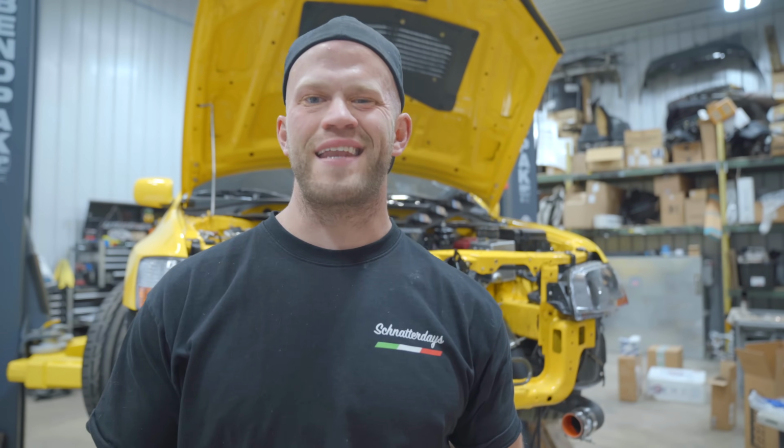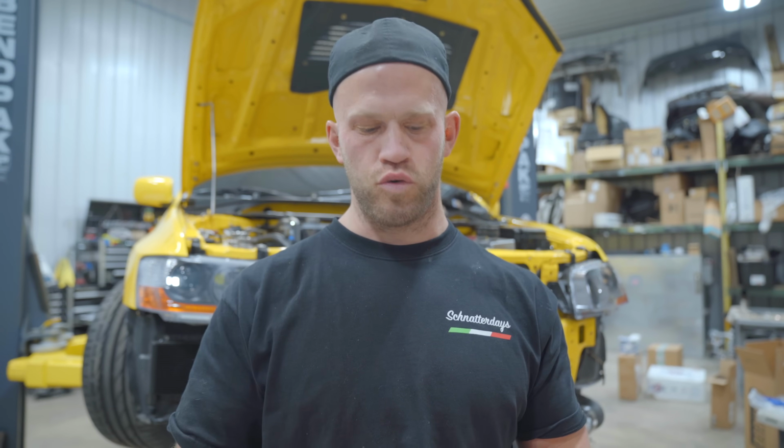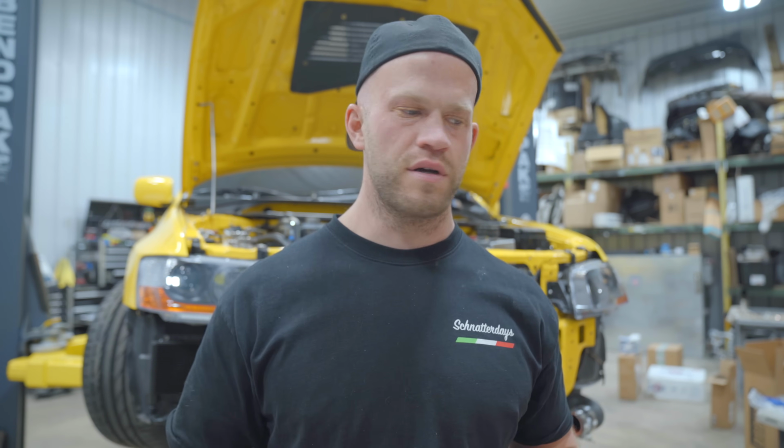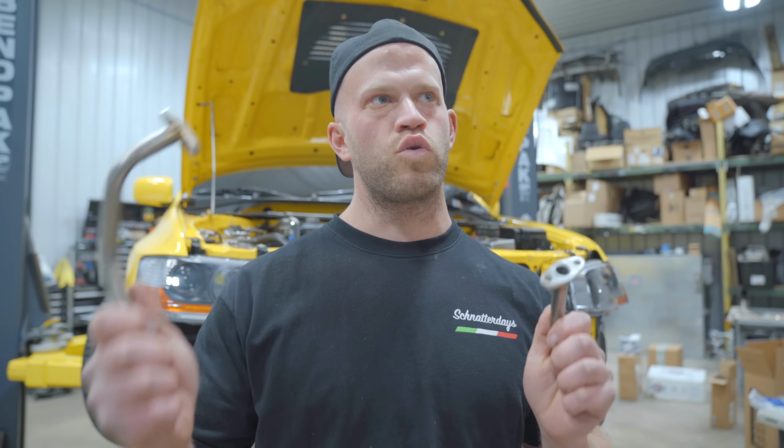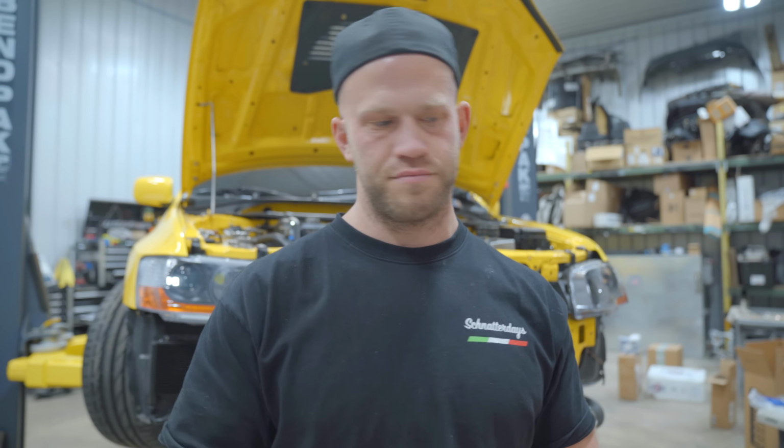First order of business today is to install all of the plumbing for the turbo. It is a water-cooled turbo, unlike say a Precision where just oil runs to the turbo. So we have both coolant feed and return and oil feed and return lines to install.